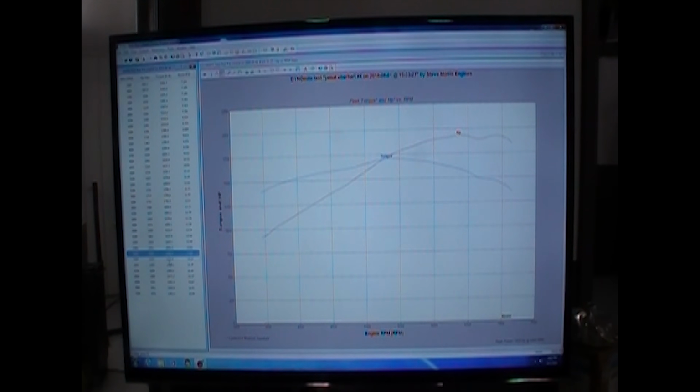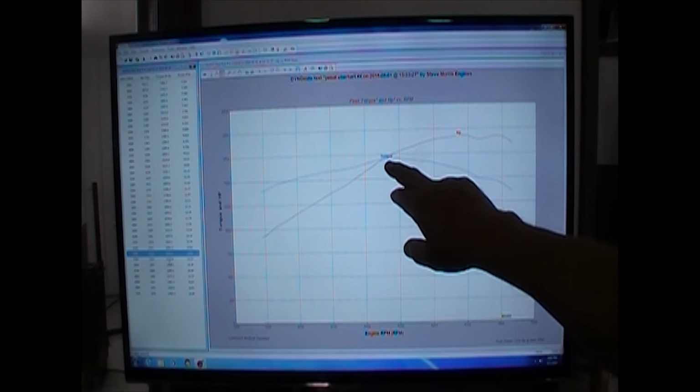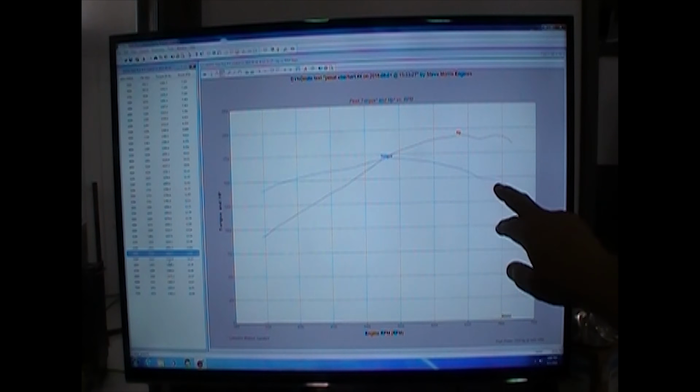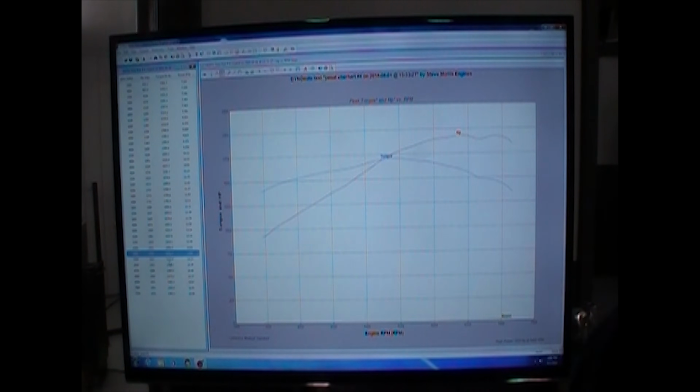So he didn't need a 10,000 RPM race motor for the car that it's going in. This is what he wanted. So anyways, you can see, that's just really nice. It's obscenely large amounts of horsepower for that kind of car. It's going to have a really hard time hooking up with anything even remotely close to that. But you can see all the way right here at 7,000, we're at 1911 horsepower, 1434 torque at basically 15 pounds of boost. And that's on pump gas.